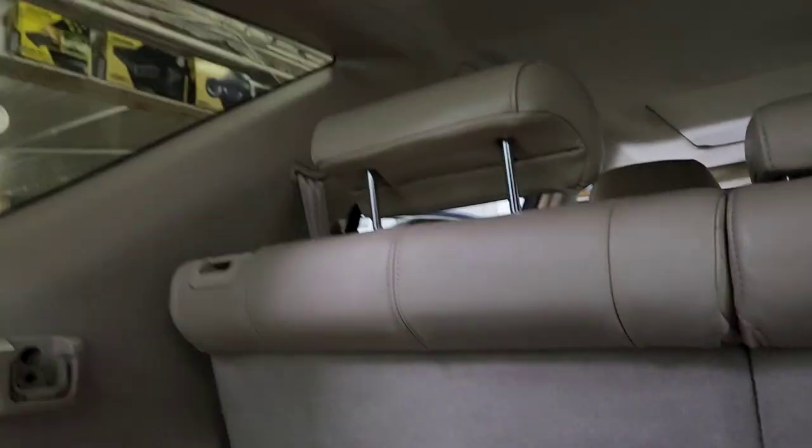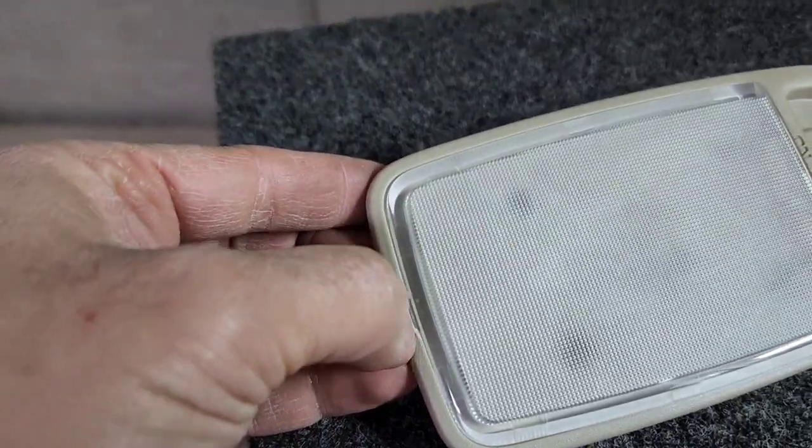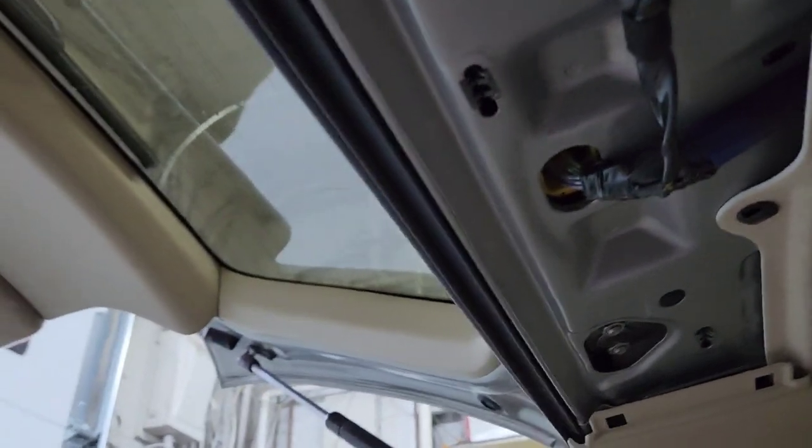The first thing I'll do, I'll remove this light right there — four screws right there, two more right there. In order to pop that out, you're going to have to take a flathead right here at this spot and push it out, move alongside to the radio. Now when you pry it out, there are clips — one, two, three, four. When you pry it out, just be careful. Make sure you pry it a little bit around here, then here, here, and there, because you don't want to pry the whole thing at once — you're going to break this plastic. It's hard to find; if you break one, good luck finding one. So now I'm going to have to run the wire right there and snake the wire through that boot right there.